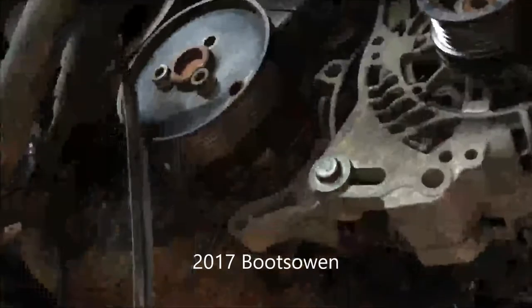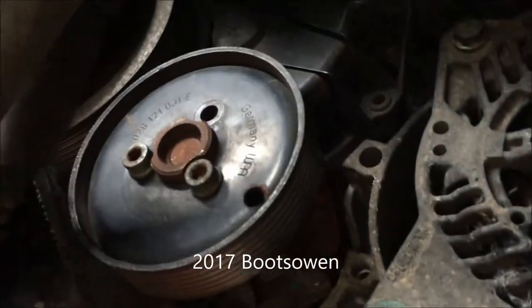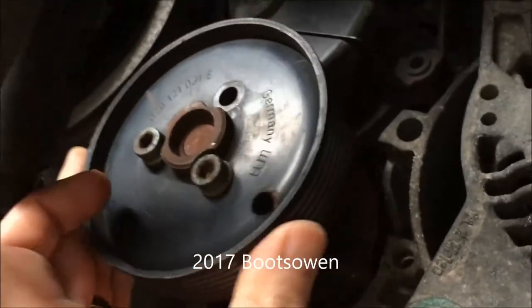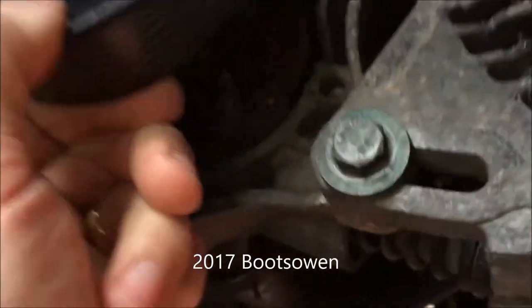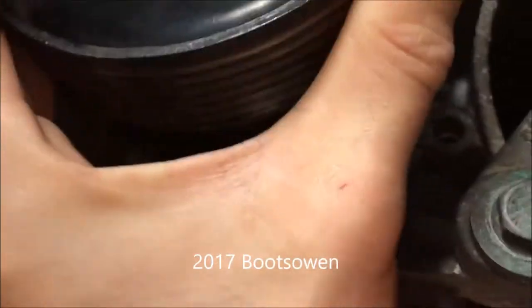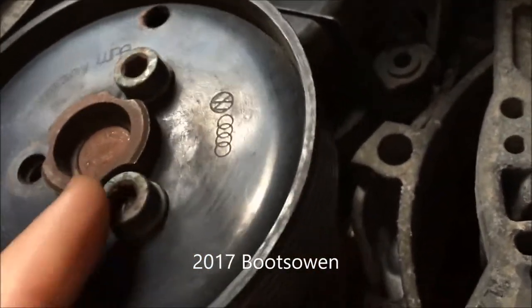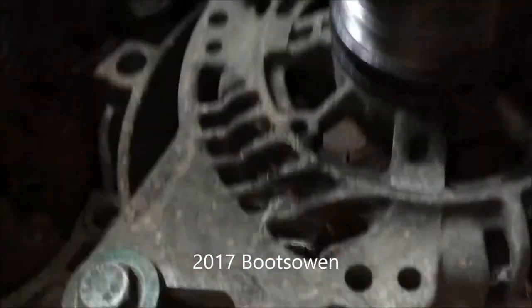I'm down underneath the engine now. I've got the belly pan off and I can see clearly what's going on. Up here, that's the water pump. That's the alternator. And the main drive pulley is this one here from the bottom end. This one here only has 2 out of 3 bolts on it, and that could have caused a very slight wobble in the water pump. The water pump feels okay — doesn't seem to be any play in the bearings. It feels quite tight still, but I'd rather take one of them out and try to get 3 replacements. You can see bits of belt everywhere.